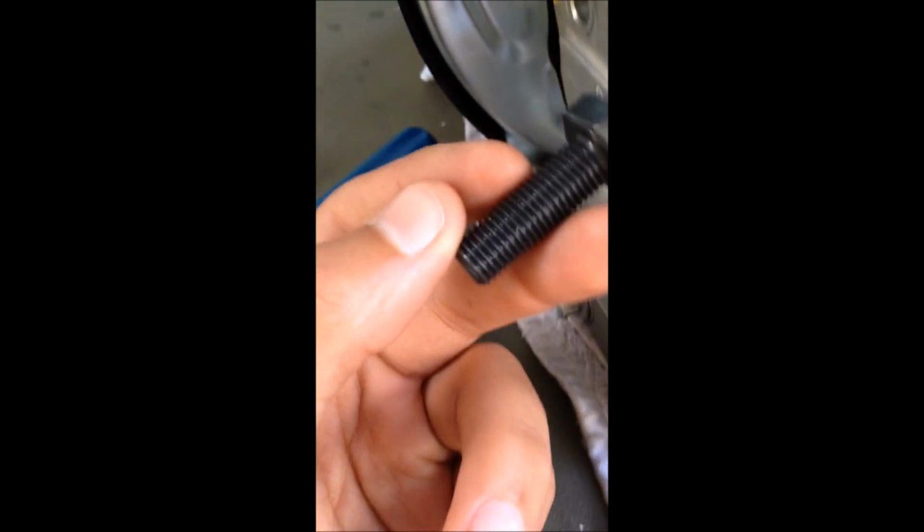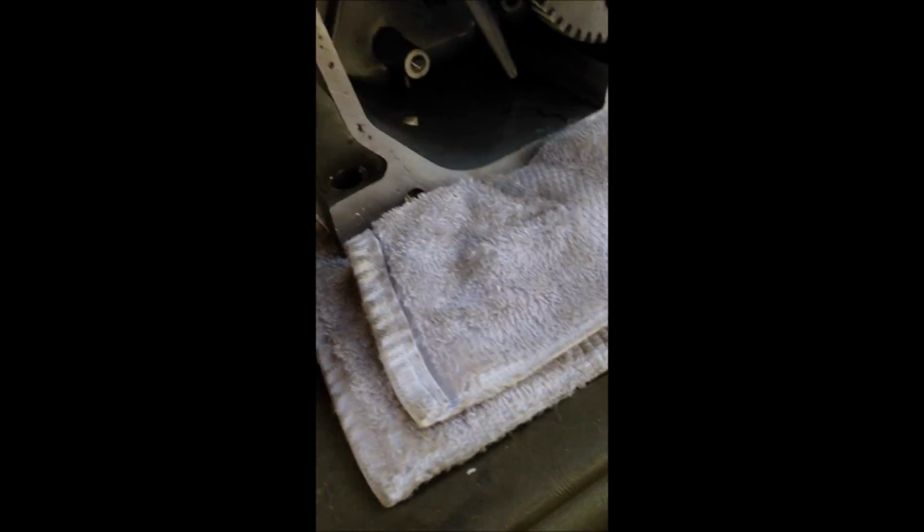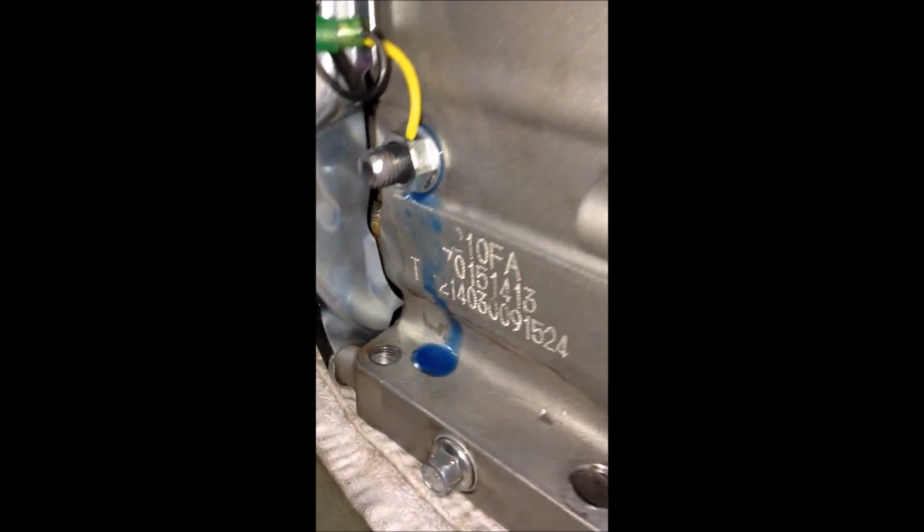This one is sealed. So next is gonna be filling in the oil sensor hole, and it'll be the same as this, except you're actually not gonna have to thread it. You're just gonna wanna buy a bolt that slides right in, and then you're gonna take the other nut that came with the oil sensor, and because if you put it in that way, the shaft is gonna hit it, so you're gonna put it in going this way, so that way it's only sticking out like that. And then you're gonna put some Loctite on and then put the nut on. Okay, so that's how it looks with the bolt in the hole of the oil sensor. That's Loctite.